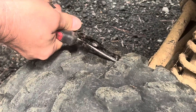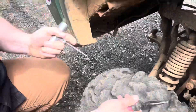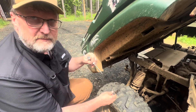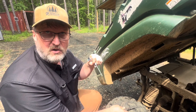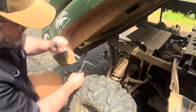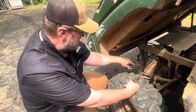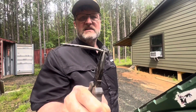You can see there's the nail — not sure where we picked that up. What I'm going to do is pull that nail and then use the reamer, which is basically just prepping the hole for the plug. Once I pull the nail out, I'll put the reamer in there and ream the hole out. I'll leave the reamer inside the tire to plug the hole while I get the plug and the inserter tool ready. That is a pretty good size nail, but we'll fix it.